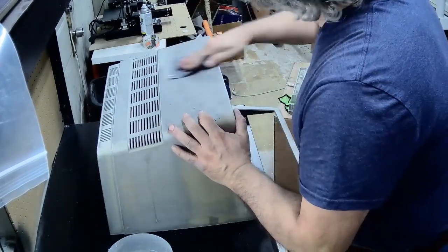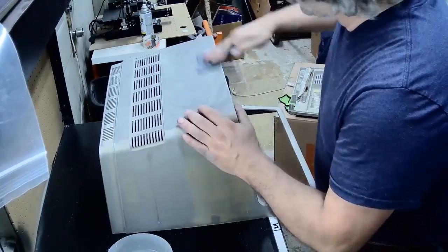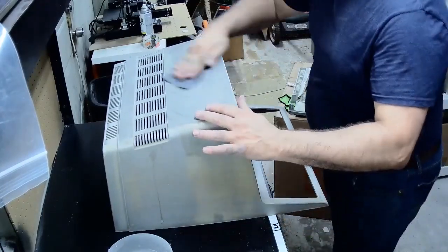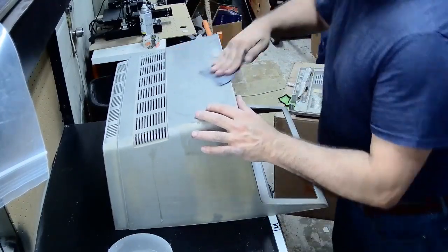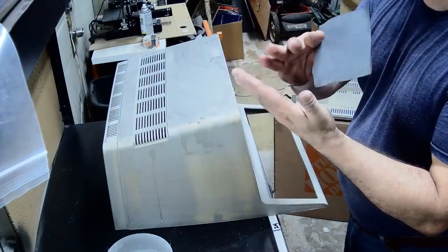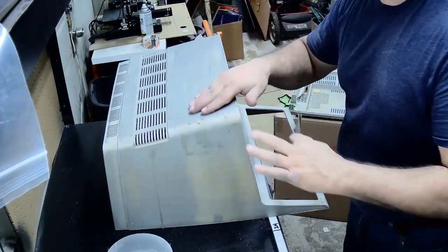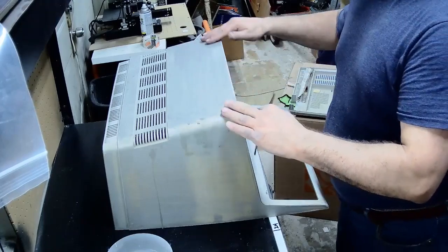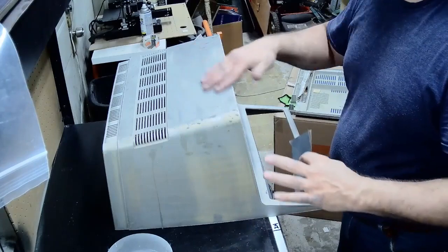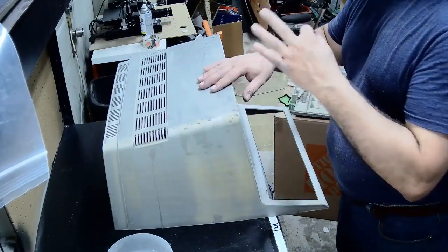And basically, this is where I start using circles. Now circles, what it does is that it does a cross hatch. What it also permits is, if the deep grooves are too deep and you scratch over, you're pushing that material into it and making smaller grooves. So when you put your hand on it afterwards, it feels like the softest surface you've ever felt. It literally feels like glass right now. You could feel it. If I had a microscope to show you this versus this, you would see the difference.